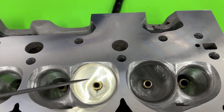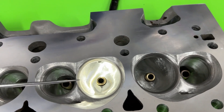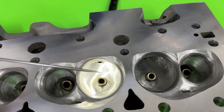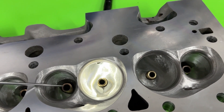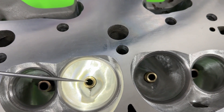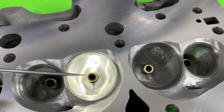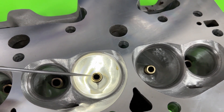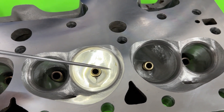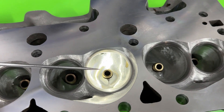The customer asked why not put in some 5/16" intake valves to reduce weight, and I said absolutely. He also wanted to go to a larger valve, so we did. We went to a 5/16" intake stem and kept the exhaust at 11/32". In case you're wondering, 5/16" is a few thousandths smaller than 8mm. The 5/16" valves are easier to come by, especially in certain lengths, than 8mm stuff.